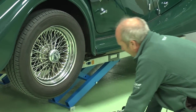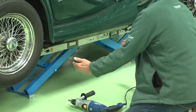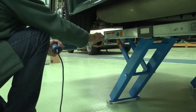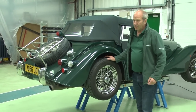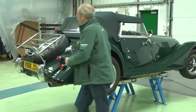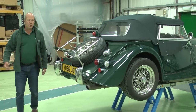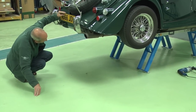As the lift goes up, there are rollers on the front which pull the front arm towards a fixed part at the back. We're just off maximum height now — maximum height will bring it up a few more millimetres, and at this position everything is good and sturdy. The car is very solidly placed on the lift, and I've got full access to the car — you can get right up the middle of the car to the back and the front.